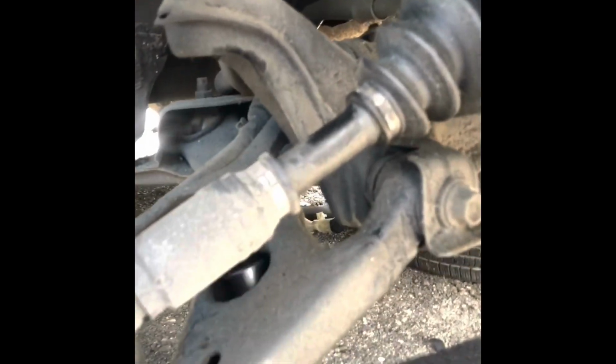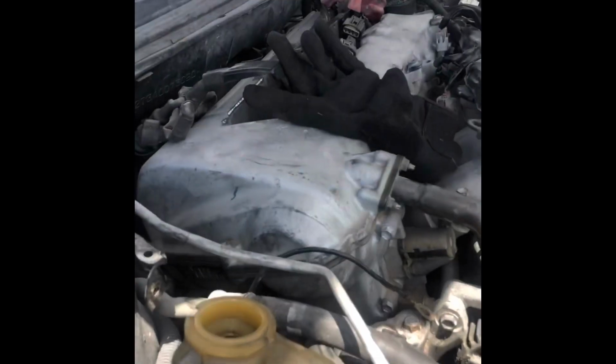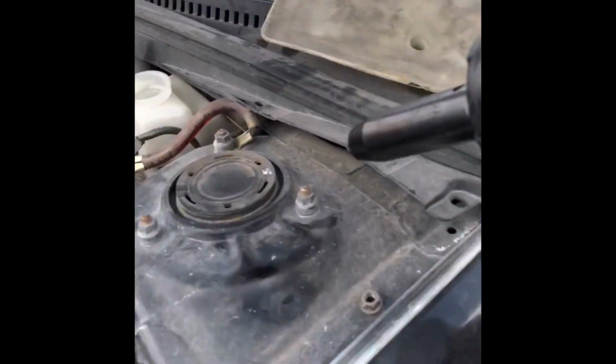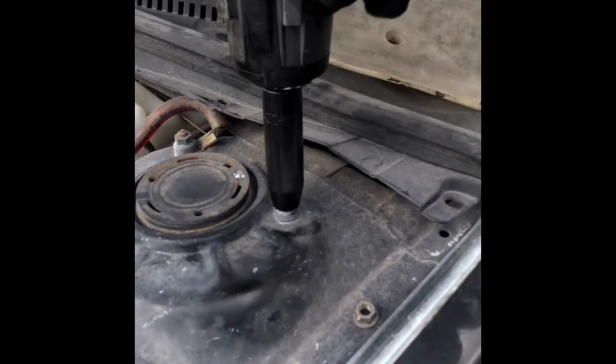When pulling the engine from the junkyard, there's something I didn't show, but I will tell you how to do it. You want to check the engine. You want to go to the crank, turn the crank, make sure it turns freely. You want to go to the bottom of the car, take out the oil pan, look underneath, see if you can find any kind of damage to the rods, pistons, crank. Check out the oil pickup, see if there's any kind of oil or metal shavings in there. Also pull off the valve cover and look underneath there for any kind of head damage.